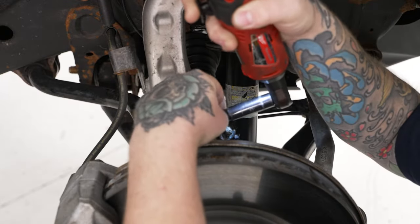This kit is an adjustable ride height kit in the front, and your kit comes with a spanner to adjust it. The lock ring is at the base of the spring perch. If you want to adjust your height up, spin this clockwise to go up — that will make for a stiffer spring and a stiffer ride, but your ride height will also increase. If you want more of a stock, subtle, softer ride, bottom this out counterclockwise all the way down. This kit comes with a specified maximum height you shouldn't go over — read that in the pamphlet that comes with your kit. To adjust, hook your spanner into the slots and spin to your desired position within the safe range.